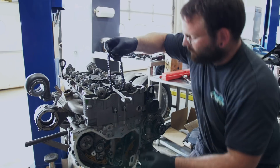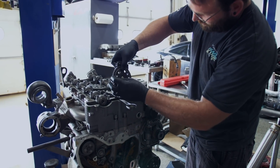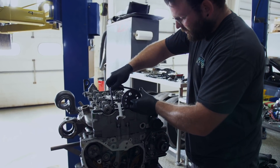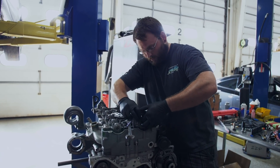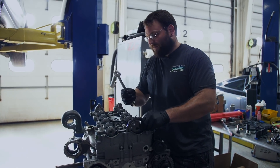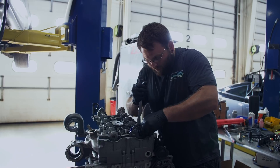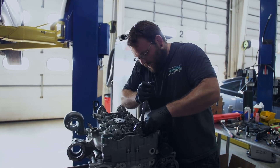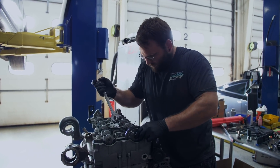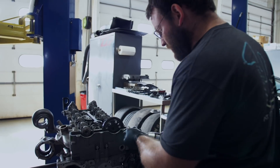Hold this tight, come up to the top and take your intake cam, and line up your intake mark with the odd colored mark. On this particular chain, it's a dark green one. There's a key inside of the cam gear and a slot on the end of the cam. You'll use a 15/16 wrench to wiggle the cam back and forth until you get the cam gear teeth to slide into the slot. Once you get that in, snug a bolt in to hold it in place.